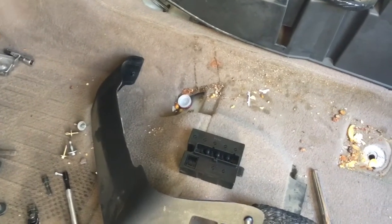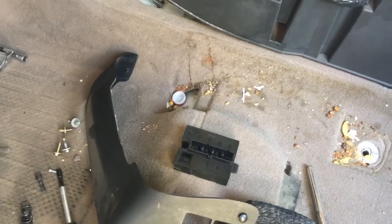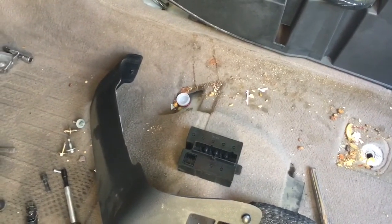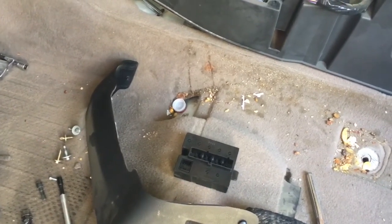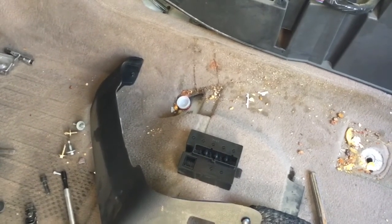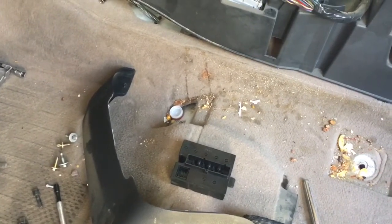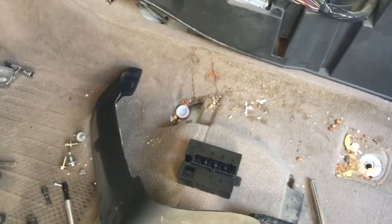One thing to consider is that these hubs operate on always vacuum. So if water got into that solenoid and it's in two-wheel drive, in theory, it would be sucked into the system, potentially then getting pushed into this system if it's shut off.